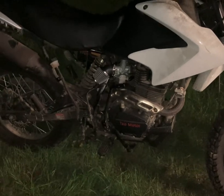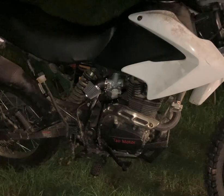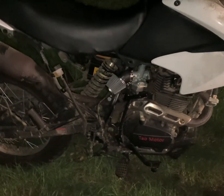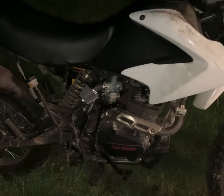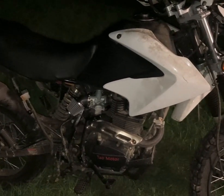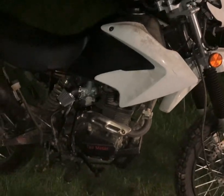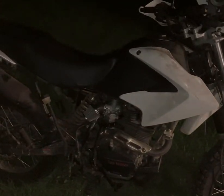For a stock TBR7 doing an airbox delete: 100 main jet, 35 pilot, and two turns out on your idle mixture screw will be perfect — at least in my area, which is the southern part of central US, Texas. I'll be changing the gearing on the bike soon and coming back to tweak these jets. Give me that thumbs up, share the content, and please subscribe — until next time, God bless.